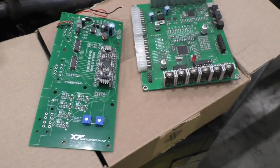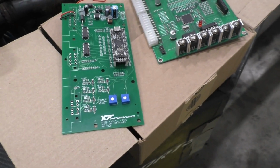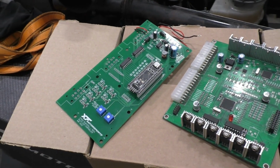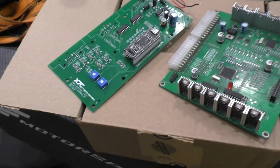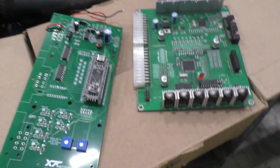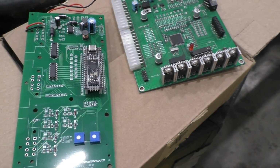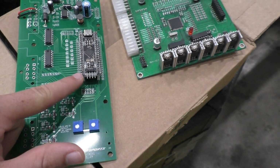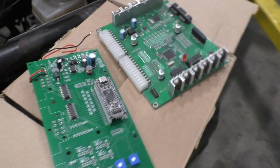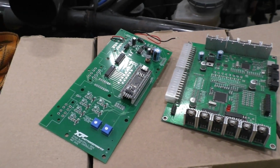All right, so this is the new board that we designed. There's a number of reasons in the way that we have designed it to try and make it as quick as possible while also still having full embedded control within the system. The main thing that you'll notice up front is we used an STM32 Black Pill, which is just one of their F411 boards. The reason we did this is because of the chip shortage.